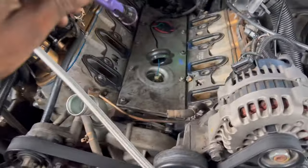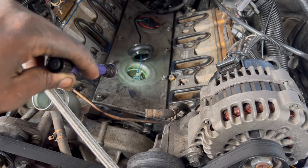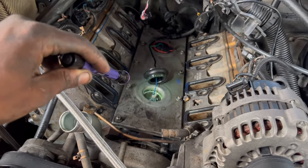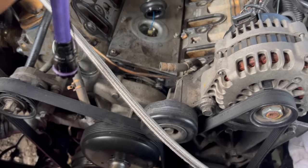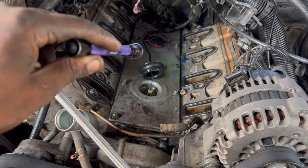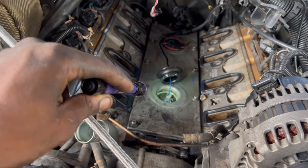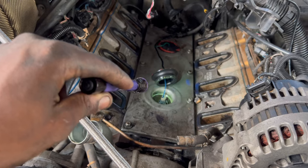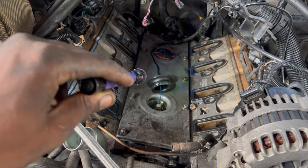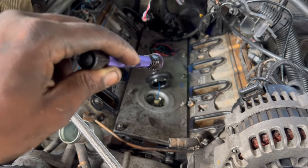What I'm thinking is, once we go on boost, it pops everything off. All I see is green right there. It would make sense if it's all on the front side right here, and on the back side of the motor too. And when you're riding, all the gravity and inertia is gonna pull it down, so you really can't indicate where. I doubted that it was coming from the rear main seal. I saw a little green spot, but I gotta make sure everything is retightened.